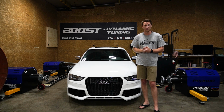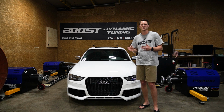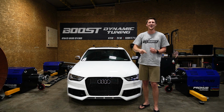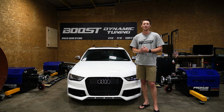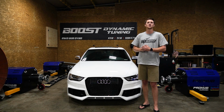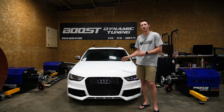Well, what I told them to do is you gotta run basic settings multiple times. I'm an Audi tech, I've done it before, it doesn't go through the first time. So if they're calling you up telling you there's issues, tell them to run that test multiple times, the basic settings. You'll probably have to do it 5 to 10 times. If they charge you extra, do it because that's the only way they're gonna get it to go.